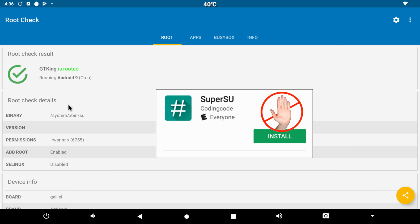The warning still remains in effect. Don't try to update the Super User app because it will put your box into a permanent boot loop that a refresh from recovery mode cannot fix. You will have to flash the firmware to restore it. Again, don't say you haven't been warned.